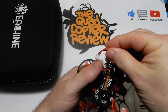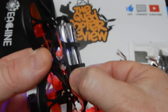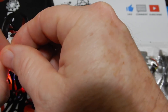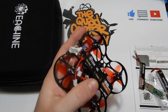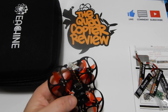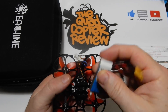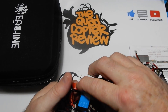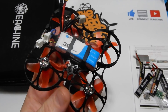One of the big defects to me is this battery tray. The batteries are very, very loose — they eject in flight very easily if you're flying acro. I had a lot of issues with them ejecting, and you actually want to make sure you drop some glue on that light bar in the back because when they eject they'll grab that wire — I almost lost my light bar immediately. Interestingly, when you switch to the XT30, the 300mAh Beta FPV batteries fit perfectly into the frame with no slop at all.